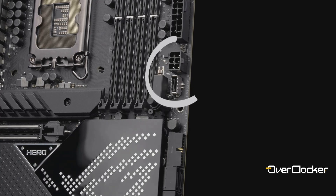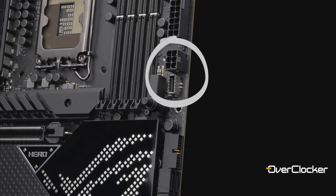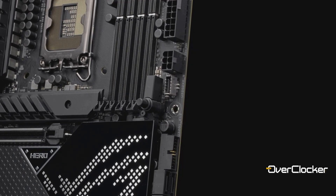On the front of the board, there are the typical USB 3.0 headers and USB 2.0 headers, but you also get a USB 3.2 Gen2 x2 Type-C header. Next to it is a PCIe 6-pin connector, which can provide up to 60 watts of power to that USB Type-C connector, enabling quick or fast charging at around three amps of current.